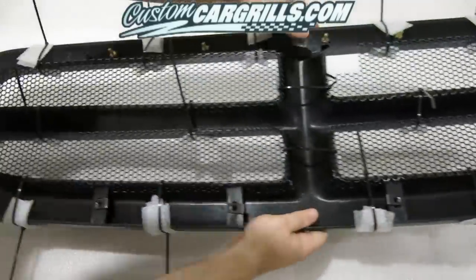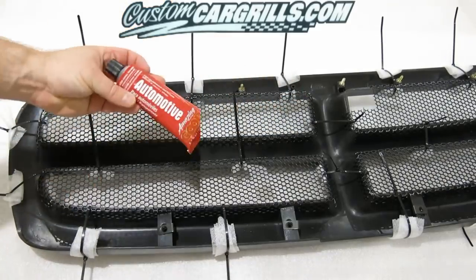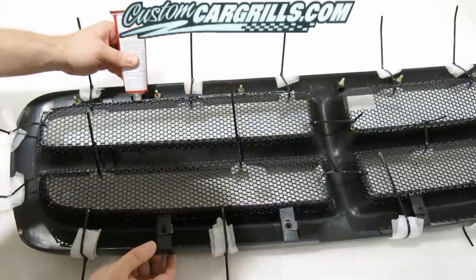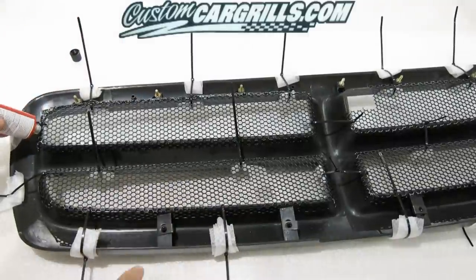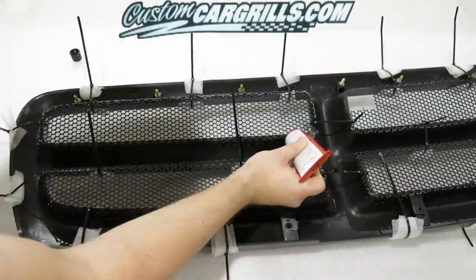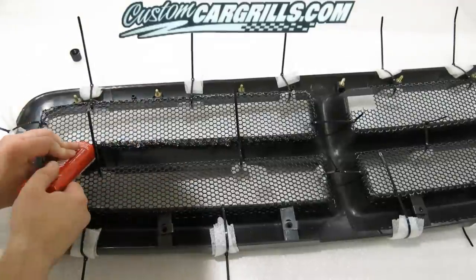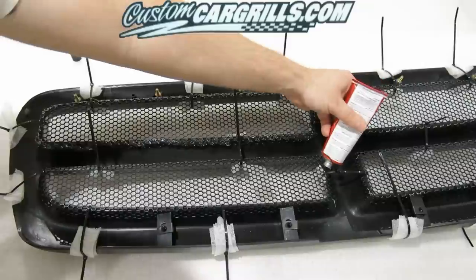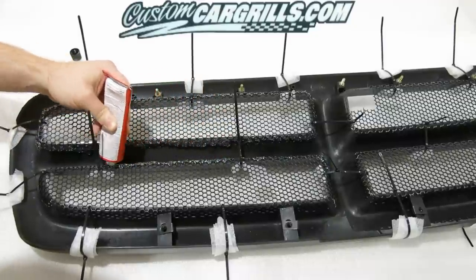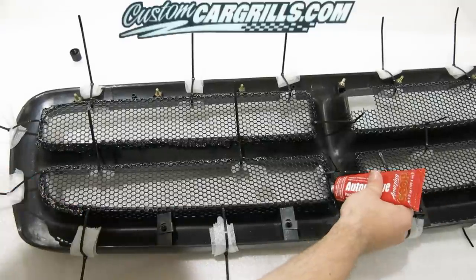Flipping it back over to the back of the grill, I think we're ready to do the adhesive installation. The basic premise is we're going to just draw a bead of adhesive around the perimeter of the mesh. The adhesive that I prefer using is automotive goop. It dries relatively quick and it dries clear, but most importantly, it's a really nice strong bond, but it's not too strong to the point where it's brittle. It's actually got quite a bit of flex to it, and that's very important when you're doing any sort of long term installation on a vehicle. You want something that's going to be a nice tough bond, but you also need it to have some flex. If you use an adhesive that is too strong, it ends up being brittle and you'll see it crack later on and will likely end up coming off or you'll start seeing gaps or it'll become loose at some point.